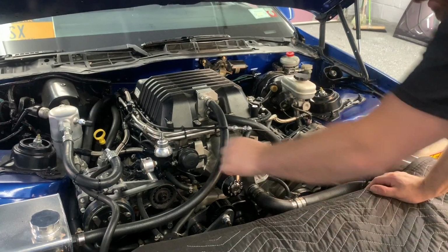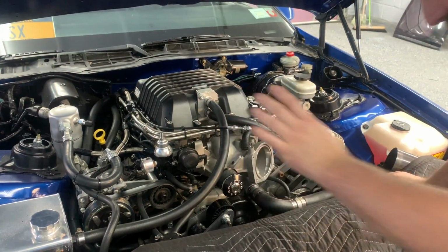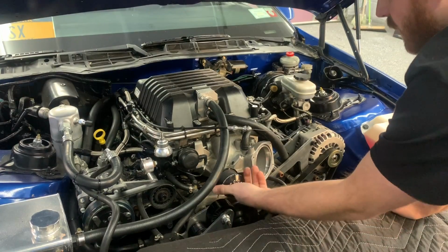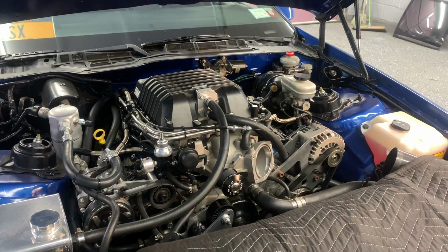But I got all the vacuum lines on, I got the regulator back on. I actually pulled out the torque wrench and torqued this thing down. I couldn't really find a set spec on it. Some stuff was saying that they're torque to yield. Lingenfelter, I think, was saying like 27 foot-pounds. There really wasn't anything I could find in the stock stuff. So I set it to 22 foot-pounds. That felt just about right. Pulley's nice and tight. New couplers in there.